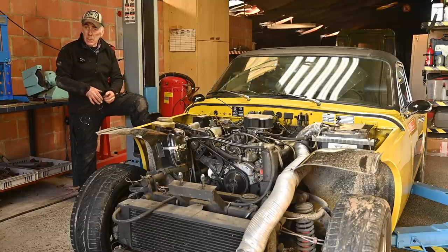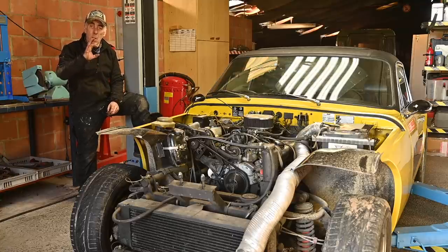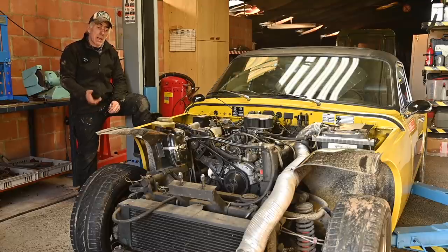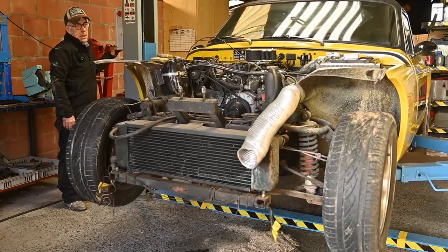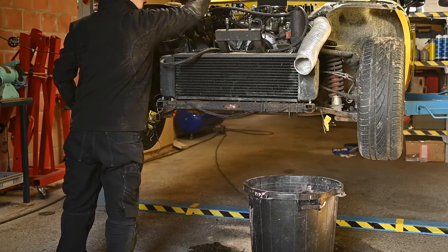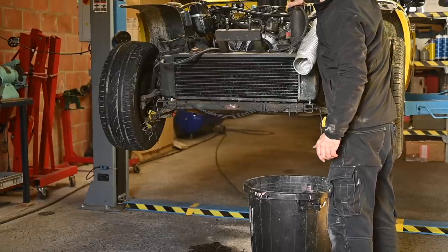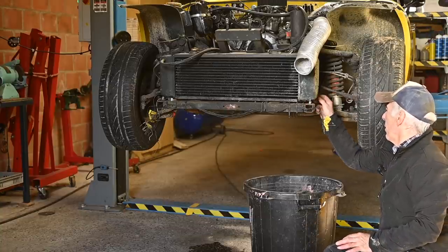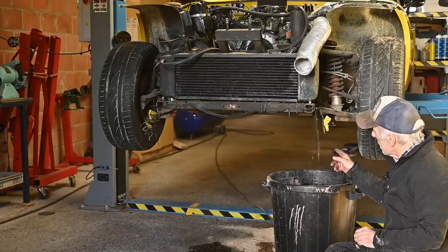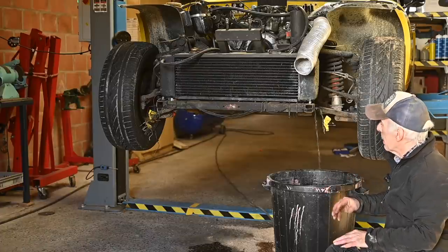With a pressure test you can detect far more problems than just doing a quick check while the engine is running at temperature. We spotted leaks on the radiator and several around the bands holding the tubes onto the connection pieces — all these bands will be replaced. Now let's lift up the car, drain the cooling liquid, and remove the radiator. I'm removing all the caps to make draining easier, then opening the draining valve on the back of the radiator and letting it run out. Check the color of the cooling liquid — this looks pretty good.